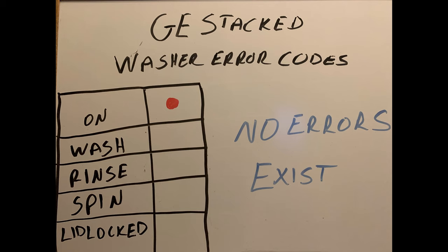It's a good tool for technicians. Just make sure there's not a problem by letting it fill, seeing if it agitates, and then draining and spinning. That's all these washers do — fill, agitate, drain, and spin.